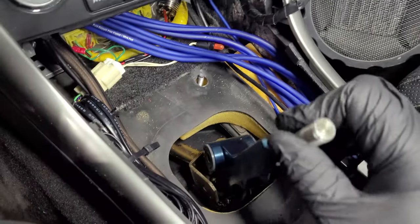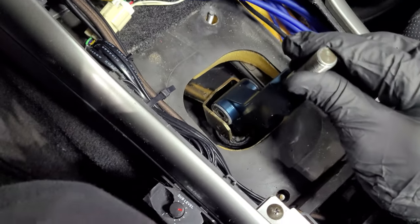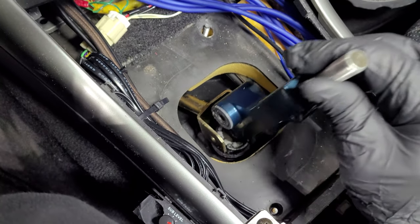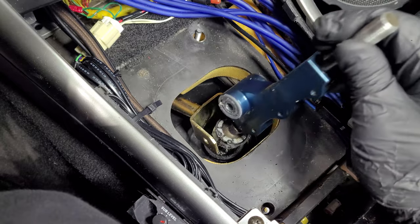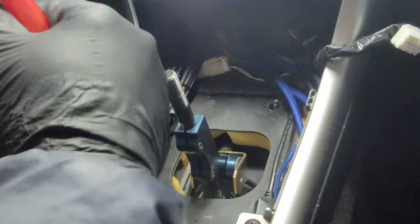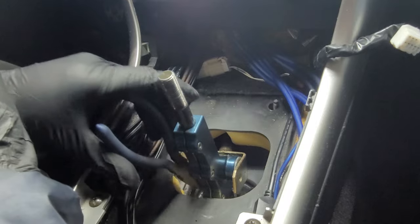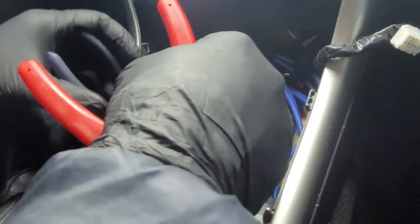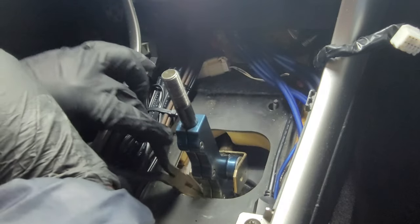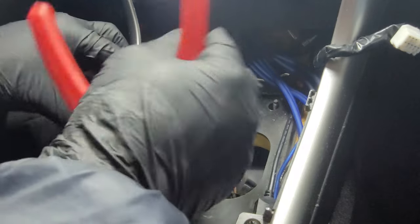Now what you want to do is make sure that the Cobb portion is facing the front — it needs to sit like this to work properly. So essentially you're just going to push the thing down the same way you pulled it out, and then take your snap ring pliers and squeeze the ring, push it in to make sure it's locked down in there. Once it's down and seated properly, then we'll start working on the shift height and the adjustment features. I think this is easily the hardest part of this install — just trying to get this C-clip back into the hole, just because of the clearance with the shifter and how tight it is in there.